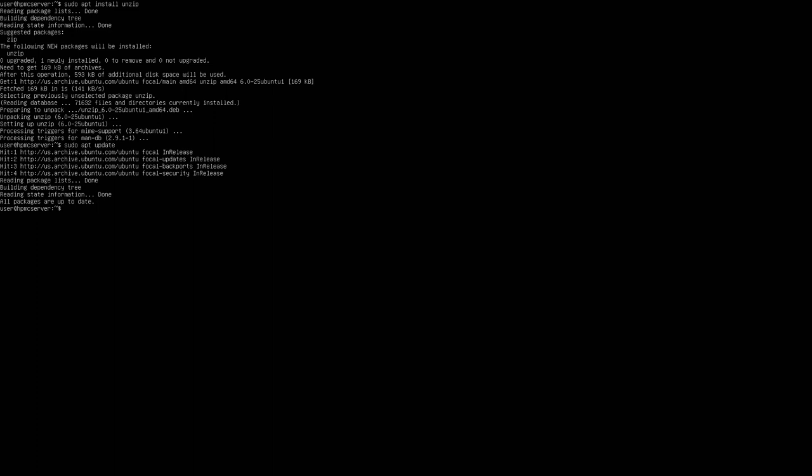So now we are going to go back over to our Windows 10 computer and we are going to SSH into this using our BitVise program we downloaded. We can do everything from command line on our Windows PC at that point. We don't need to use the server screen to do it. It also helps for copying and pasting and whatnot. So I'm going to head back over there. Oh, yeah. So before we do that, we need to figure out what our IP address is.